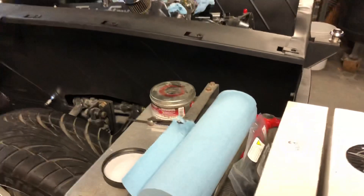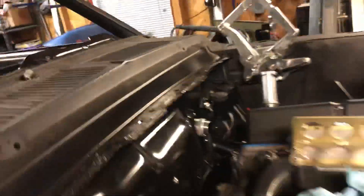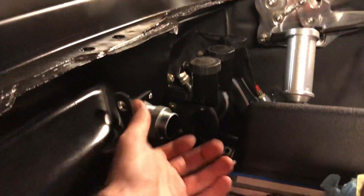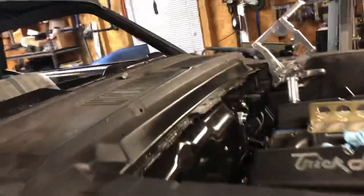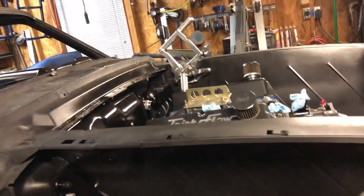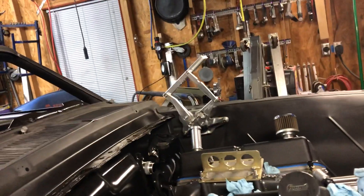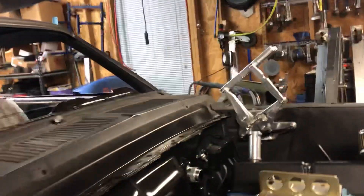You need more pins than you expect, so do what I didn't do: get the double bulkhead. It costs more, but if nothing else it just sits there in the engine bay, or you can buy caps that go over it. Otherwise I'm gonna have to go back, buy another one, drill another hole, and remount it even though it's already nicely done.